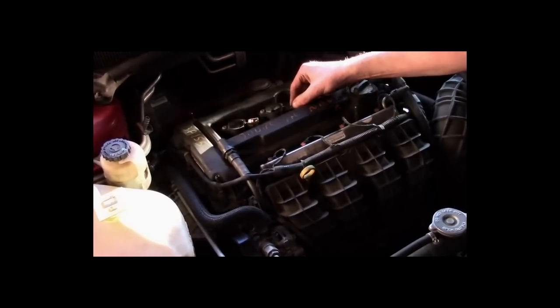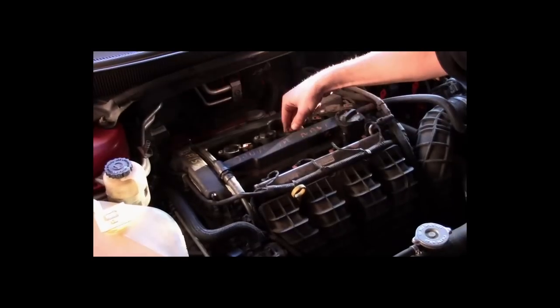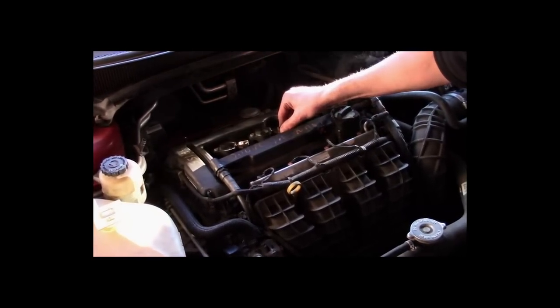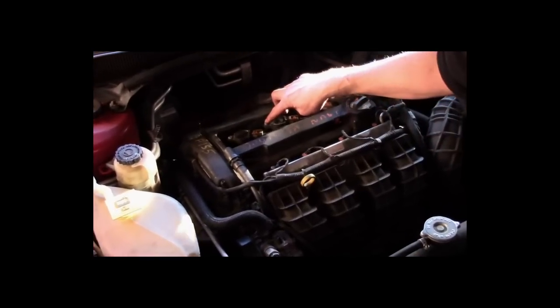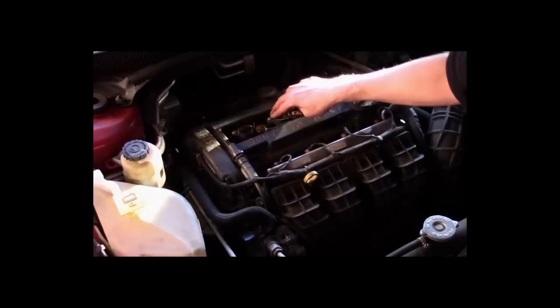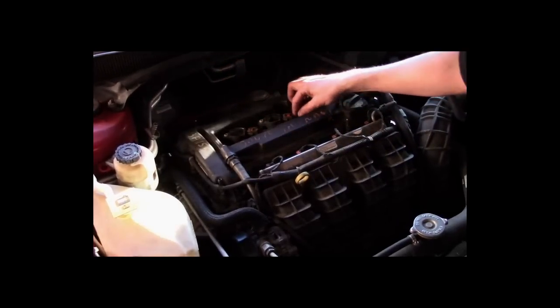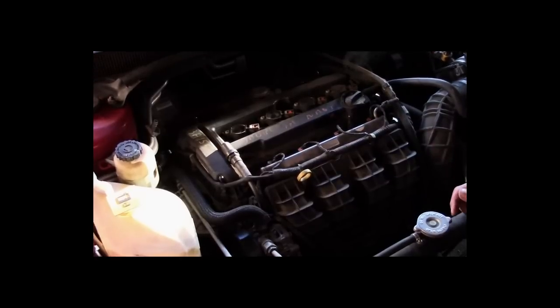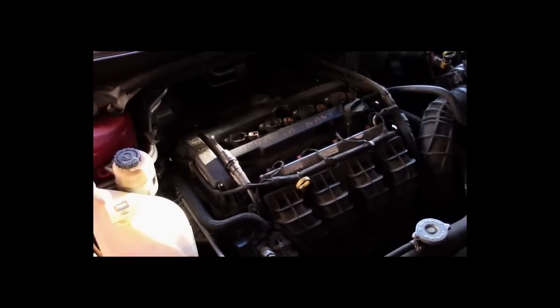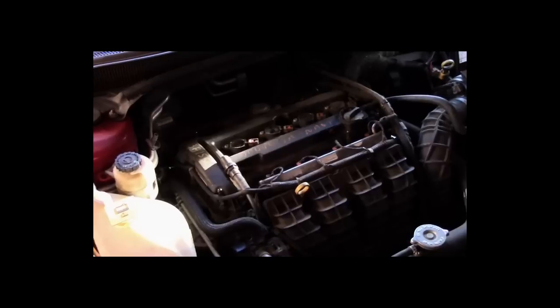Right there. No. So they don't notice it, and that's okay. Right there. Hear the idle change a little bit? Let's see, we got Torx bits on these cylinders, so I can't remove this to check that it's sparking. We have to do a compression test on this engine right now. Our variables are there's no fuel, no spark.